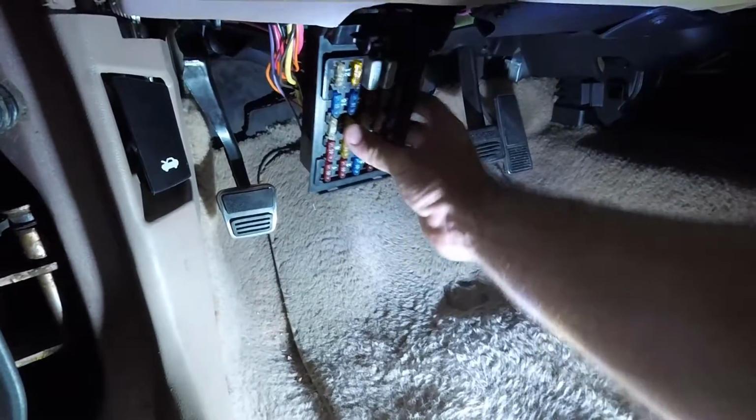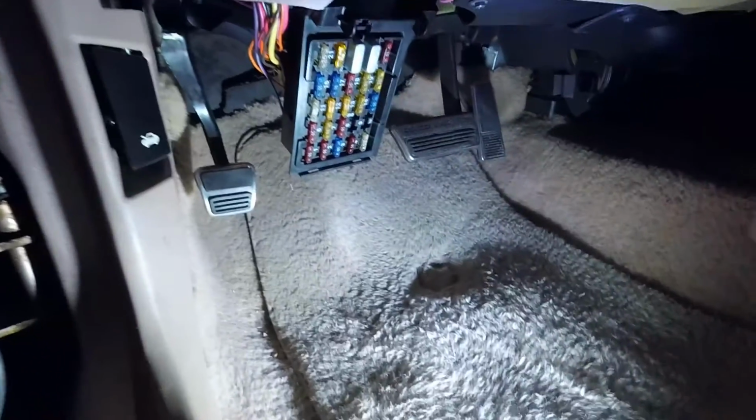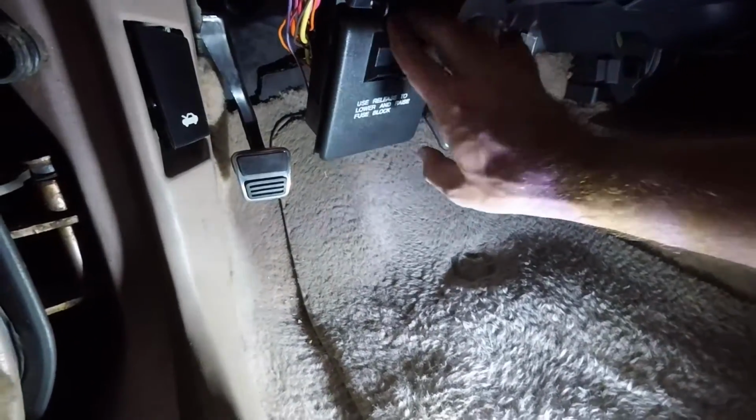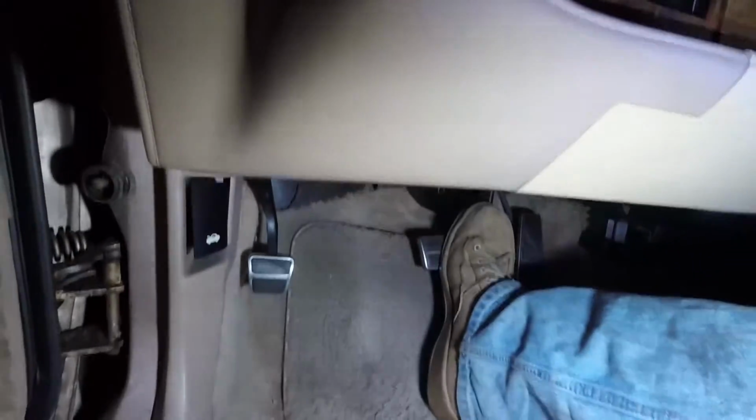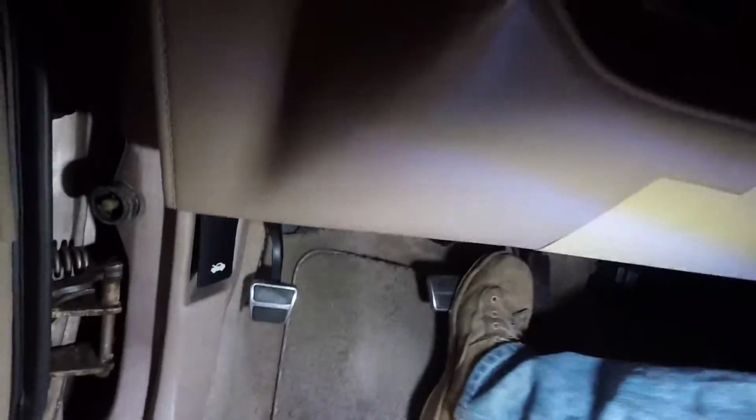So after that wonderful little time lapse, you'll see that the caddy is back on the ground. Everything's good to go, except two things. The first thing being this fuse for the electronic leveling control. Let's put that back in. And what did I say yesterday was probably the most important part of this. Yeah. You gotta pump that brake pedal so look, it's nice and hard.